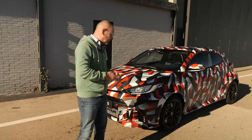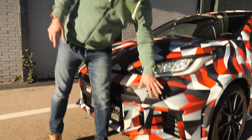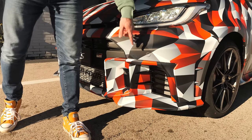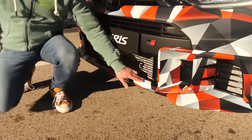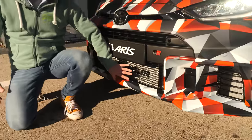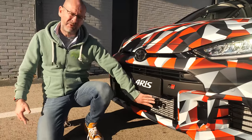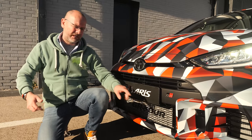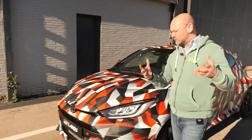Like Toyota has done quite a lot. The old bumper — if you nerfed a corner of it, you had to replace the whole bumper, which in a race situation could take quite a long time. It is now in three easily changeable pieces. At the same time they've opened up the aperture to increase cooling to the engine, and this mesh is now steel rather than plastic, so if somebody in a race chucked up some marbles and broke it, it won't go straight through the radiator.